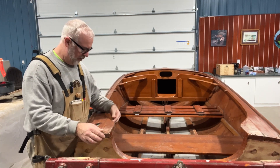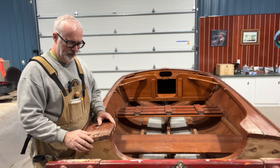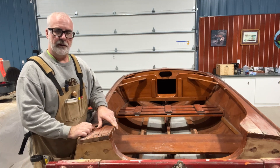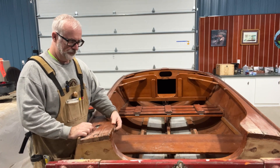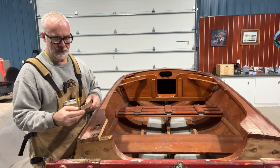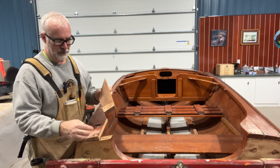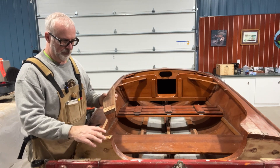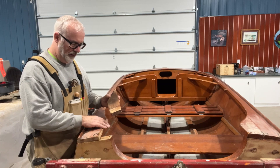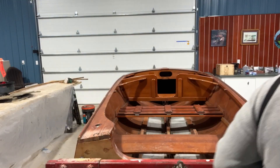This one slid forward, so I'm going to re-glue it and clamp it. I think I'm going to clamp it without screwing it down, just to give it some chance to move. Before I do that, I'm going to dress these bottoms — there's some bad old fairing compound, or somebody stuck something in the back seam with the transom area. I'll get that cleaned off so it'll sit better, and I'll clean up this joint and glue it on both sides. For the other one, I couldn't find the fastener on the top.